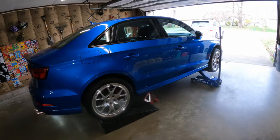I did the Haldex already. If I do these front and rear diff — the front is a combo transfer case from what I'm reading — and the engine oil, I think the only thing left that I would not have touched, aside from brake fluid and coolant, is the DSG. I have all the custom DSG tools to do that too. In the next year I might do the DSG fluid to get everything super fresh. I don't think I did a DSG fluid on this one yet.